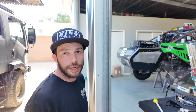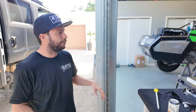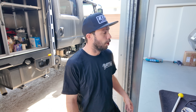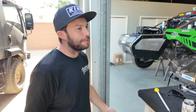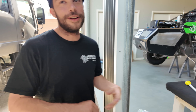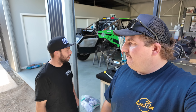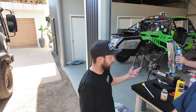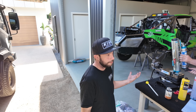So what does it mean when you re-spring on a flat ground setup? Depending on what track you're at, you want a certain amount of ground clearance, bump clearance. You want the thing to not have too much pre-load, like a car that's sprung too heavy. When you say you're re-springing it to a flat ground setup - you're re-springing it to the perfect setup on flat ground. Find some concrete and you're springing it to sit at the correct height, so all the bump stops and all the travel and everything is right. Because if everything's sitting too low, the shocks are position sensitive - the springs work differently with different amounts of load on them.